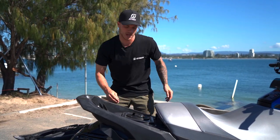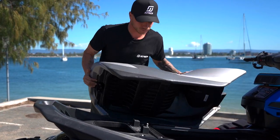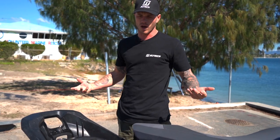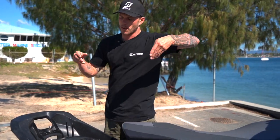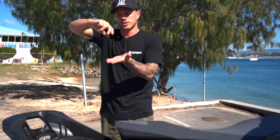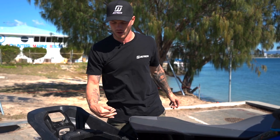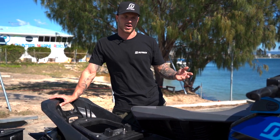A very important thing I fit to my ski: I put tow taps in here. A tow tap is something I think everyone should fit — I don't know why skis don't come with them from the factory. If you break down, you can't tow your ski faster than six knots without a tow tap, because water goes back up through the intake pump into the exhaust system and will flood your engine. The tow tap is fitted at the bottom; it takes maybe an hour or so to install depending on the ski. There's a tap you switch over that blocks any water going in, so if you break down you can tow your ski at 15 to 20 knots and it's perfectly fine.